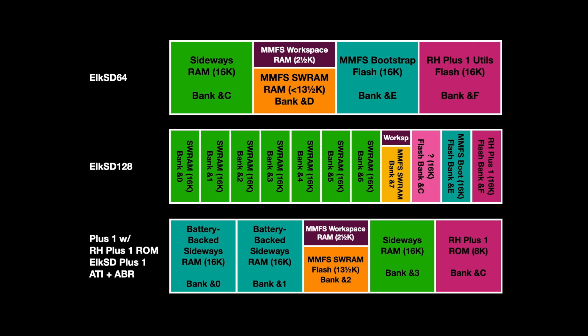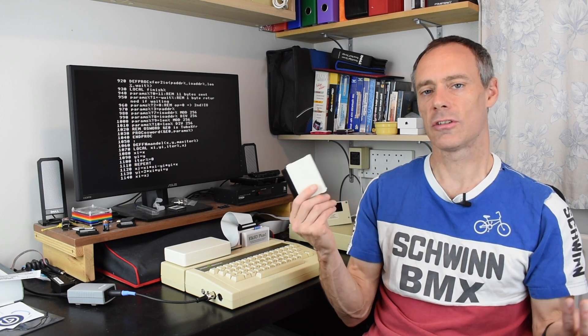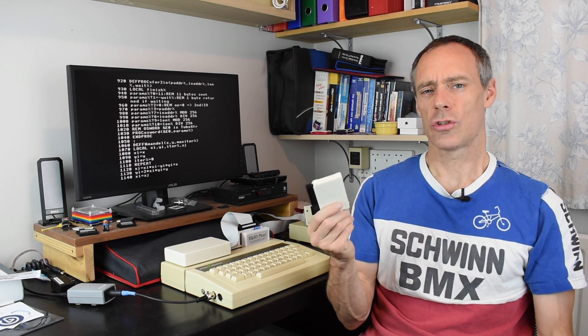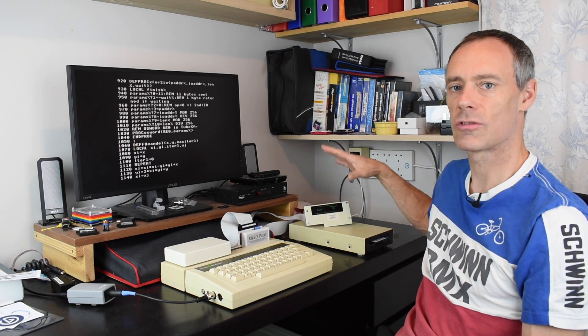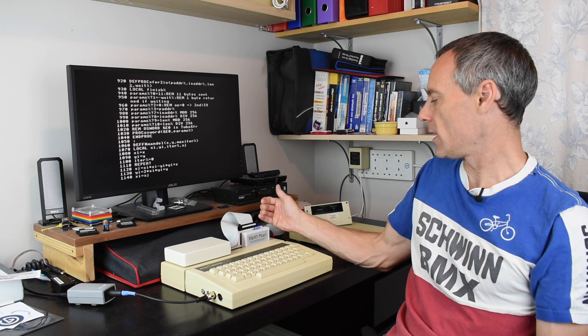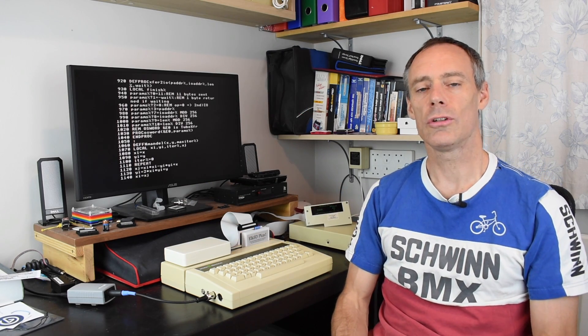So there you are — there's your three options. Which one should you get? I think the straightforward choice for most people is the SD64. That lets you play a bit of Chuckie Egg, do a little bit of programming, it's cheap, it's easy to install and you don't need any extra hardware except an SD card. For people who want to do a bit more programming, load a few utilities and language ROMs in, probably the 128 is a better choice. It has a joystick port — I don't feel many Electron games really need a joystick, but you don't lose anything over the 64, except £25. The Plus One option gives you a lot more flexibility to install things like tube processors, you can even replace one of the cartridges with a disk interface to run a real physical disk drive or maybe a GoTek — but you do have to have a Plus One which costs extra money, you end up with this great big box sticking out the back, and the ATI ABR cartridge isn't available right now, so that's a bit of a niche choice. But whichever one you pick, they're all good, so I hope you found that interesting, maybe even useful. Thanks for watching and see you next time.